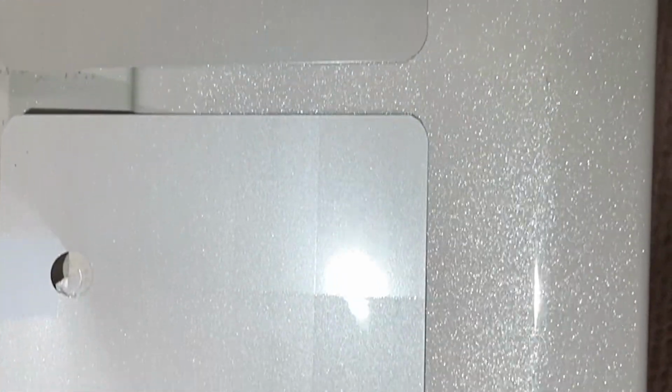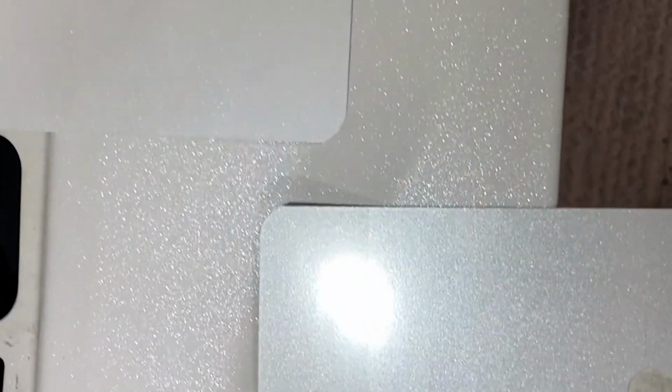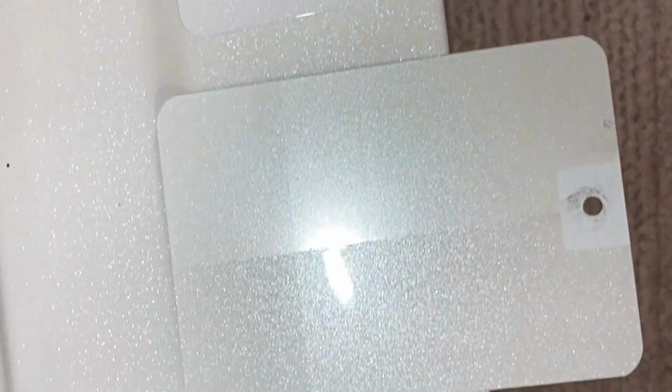In this case, I didn't get an exact color off of the camera. I had one color that I liked, but it was too light, so I added 10% yellow, 10% black, and then I sprayed it. I did a letdown panel. The metallics were actually still a little buried down deep, and in the vehicle, they were really standing up.